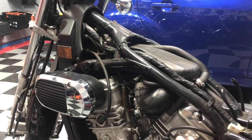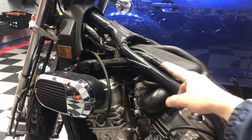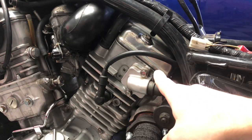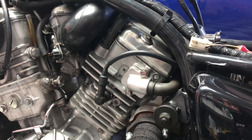If you've got the ear shave mod, which is basically the pod filters sticking off the carburetor on either side, your hose system will look a little bit different than mine. I have the stock reed valve system installed. There's one reed valve for each cylinder. If you don't have these, your previous owner did what's called the coaster mod and removed these to prevent the deceleration popping from the exhaust and also to declutter.